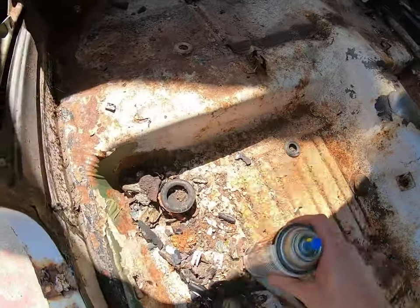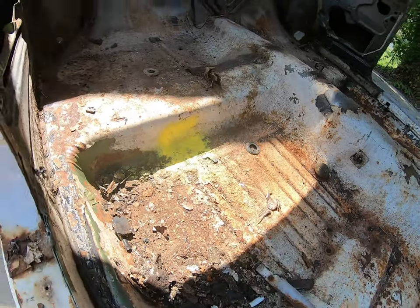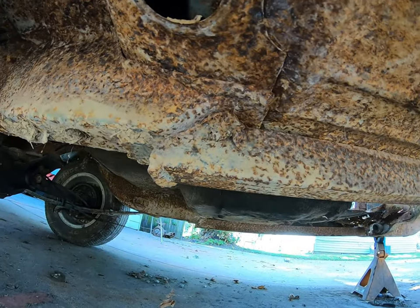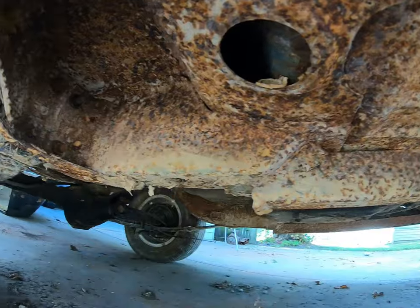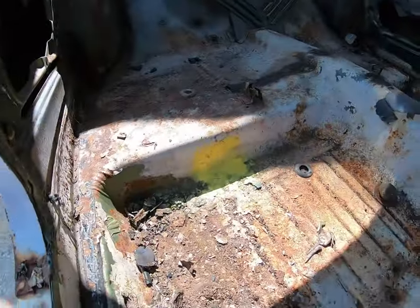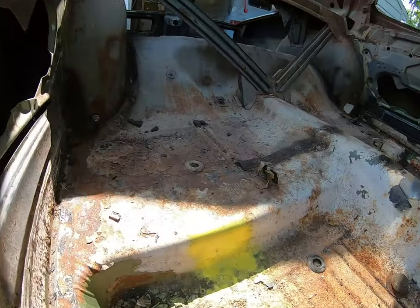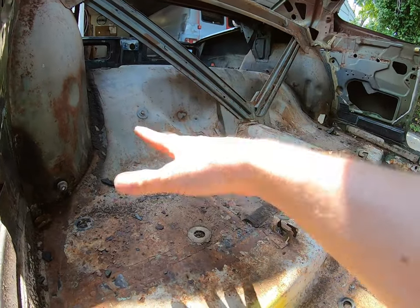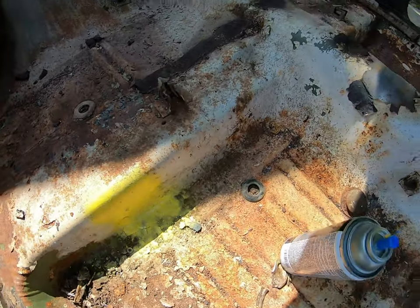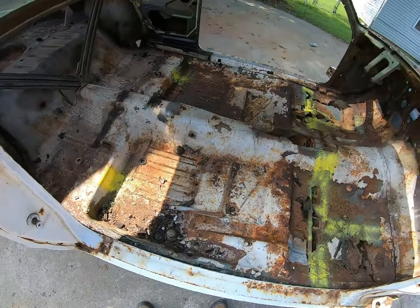Back here there's some of this garbage out. The frame rail kind of lips and it ends right here — that's your frame rail. And here's the subframe connector, which is basically just a piece of square tubing. We might do something different with that later, but at the moment it's actually helping us. Right here is the end of this frame rail, and it's just as wide as the one up front. It pretty much terminates from the floor pan in here. There's a little bit of a piece of this section which I just call the back seat embracement — it goes and lifts underneath here. So as far as how it connects to the floor pan, that's that. Your rocker panels down through here — that's what holds this car together in this bottom end, as well as the roof on top.